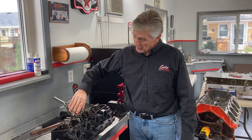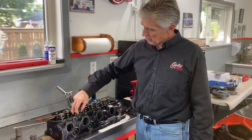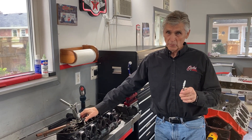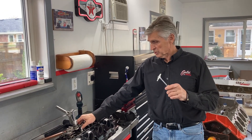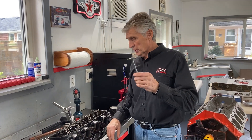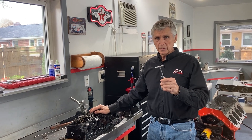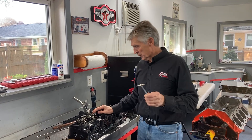The highest-end, most expensive way to do that is to buy a spring micrometer that fits over the valve — it works just like any other micrometer and measures the exact height of the installed spring. The problem is they're fairly expensive, and if you do a lot of different engines you might need a number of them because the install height and spring/retainer diameters vary. So here's another way to do it that's accurate enough. One of the important things when trying to do precision measurements is repeatability. If you use the same method multiple times and get exactly the same result, it's probably a solid method. If you get a different result every time, don't just pick the last result — it's probably wrong.